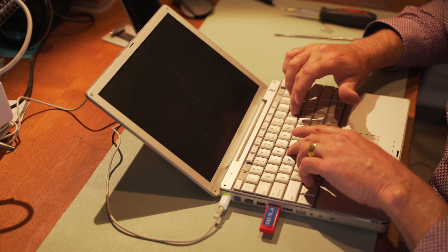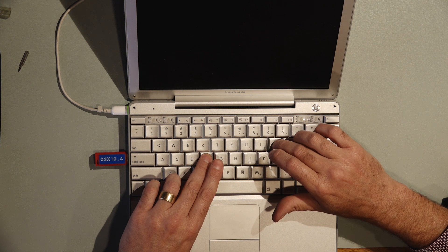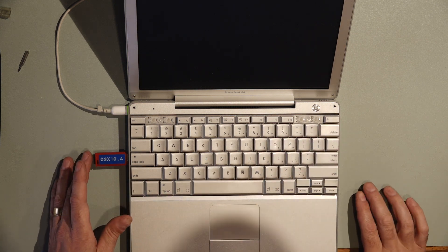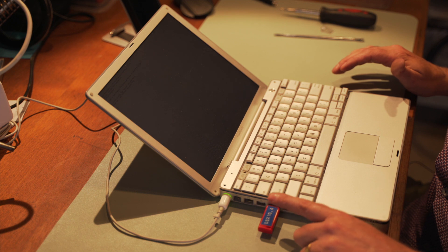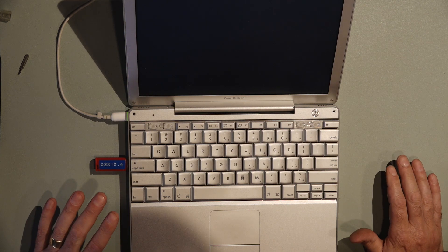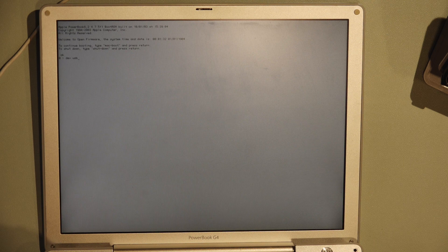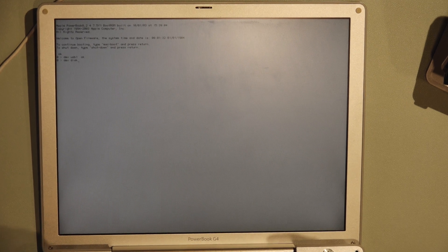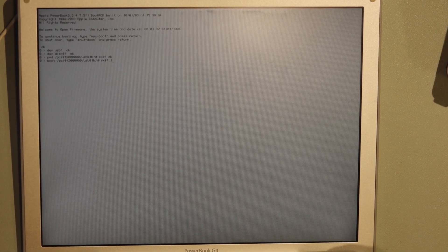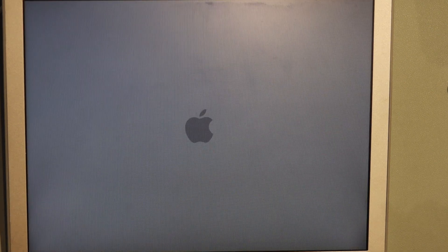It's booted up and straight away I'm getting the question mark, whereas before it would take five to ten minutes to show up — so I think it sees the drive. I'm going to try and actually install the OS on here before I do all the screws up, just because I don't want to have to do that several times. The way I like to install the OS on these G4 machines is via USB. It's not designed to be installed from USB, but we can hack the open firmware to make it boot from the external USB drive and install from there — I just find that a fun thing to do. I'm going to let that boot and install OS 10.4, do up all the screws, and come back.